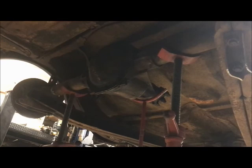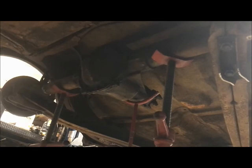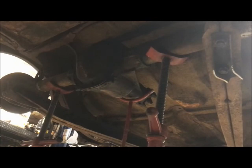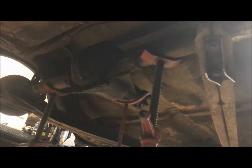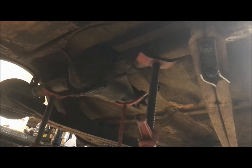Just make it the same as a G-body and call Moser and have them send me some custom axles. You know, they say, give me a G-body axle, you know the dimensions, or give me a Crown Vic axle, you know the dimensions, and make it the same length as a G-body. Or I'll measure it up when the time comes. But basically, it shouldn't be a big deal. So I could build an 8.8 to replace the G-body rear anytime if I need to do that.